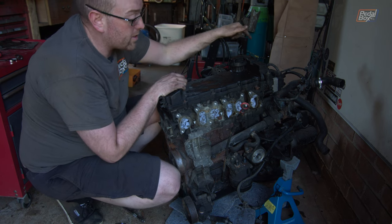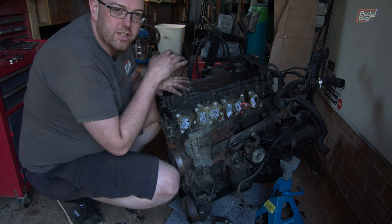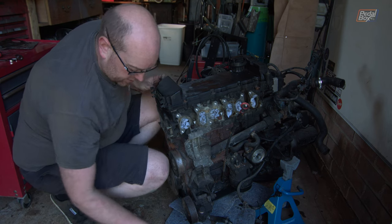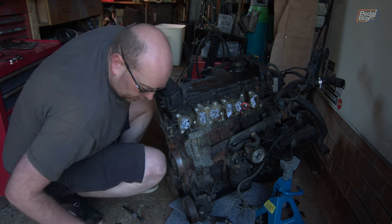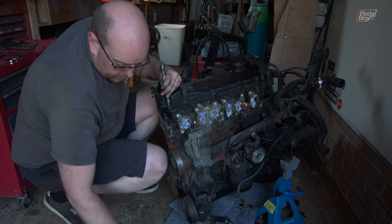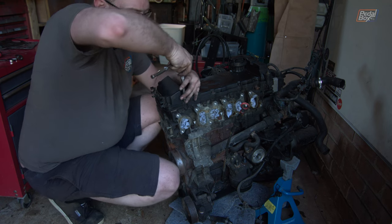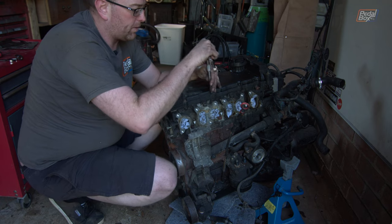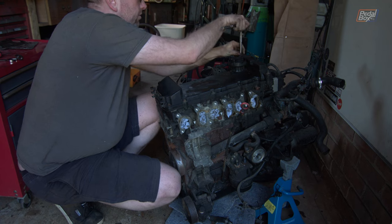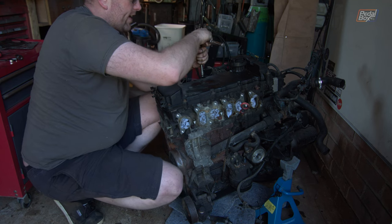The next major step is taking off the gearbox so we can get the engine onto a stand and see into the bottom more easily. But before that I'm going to indulge myself and take the rocker cover off, because I'm extremely curious to see just how bad it is underneath. It's a 10mm — not a 13, I should know better — and I even have one to hand. I'm expecting it to be pretty bad, with evidence of bearing material in the oil, and we'll need a big flush to clear all the metal from the top of the engine and all the oilways.